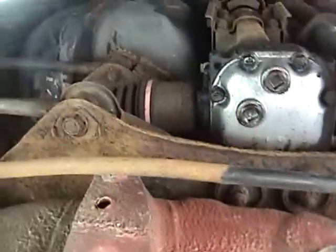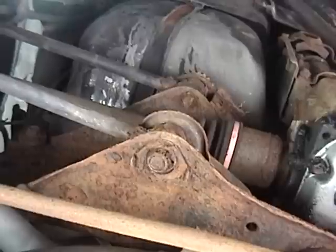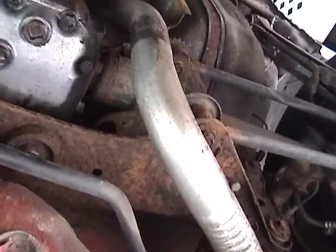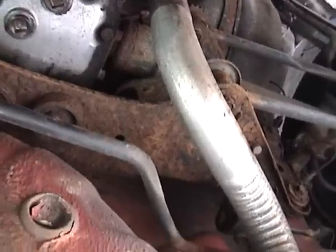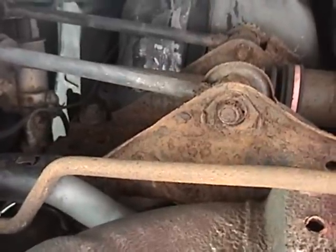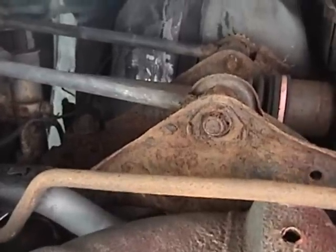I've been scraping away with the wire brush for a couple of minutes now, so I'm pretty much ready to break out the brake parts cleaner and clean this up so I can then get to using the Miracle Paint. Thankfully, as nasty as this looks, it still appears structurally sound — just really scaly. Actually, Subaru did issue a recall on this. In the late 90s there was a problem with these suspension carrier beams rusting out, and the Subaru solution was basically what I'm doing right now — cleaning it up and putting some rust proofing on it.